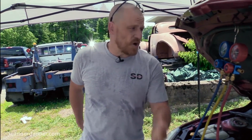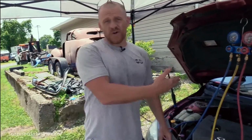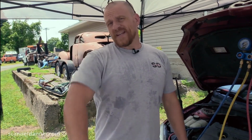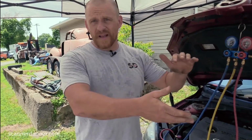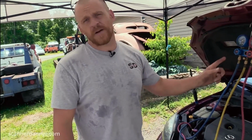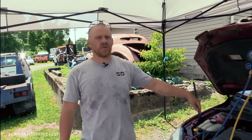And so the customer putting his own refrigerant in this, basically what he did, if he got any in at all, is he overcharged the system. Now, back to our analogy, picture my container with the liquid in it. Is there a way to tell it's overcharged with our pressure temperature relationship? And the answer is no, because there's a whole big area where we can put more and more and more liquid in, but you still have vapor area and your pressure temperature relationship is going to be fine. So an overcharge cannot be identified by a static rest pressure test. A fully charged system cannot be identified with a static rest pressure test. A near empty and empty system can be identified. What this test again tells us, we have enough refrigerant, this clutch should be turning on.